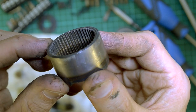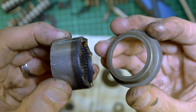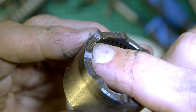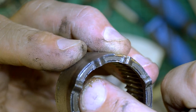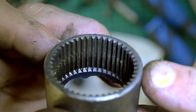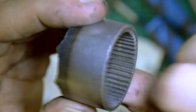This is the part that goes directly onto the drill's chuck. Here's our ring gear - you can see it's had a bit of a hard life. The way the torque system works on most drills these days is that they use ball bearings, and they jam the ball bearings between little humps. This is our ring gear, and there you can see there are the little humps. After 10 years of hard use - this drill has been used a heck of a lot - look at the surface. This is where the balls run over for the torque system. The edges here are actually very sharp, but if you have a look at where the balls have been running, it's not really worn. The teeth on the ring gear don't seem to be worn at all. That's very impressive for a drill that has done a lot of hard work in its life.